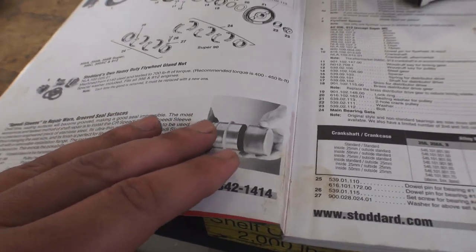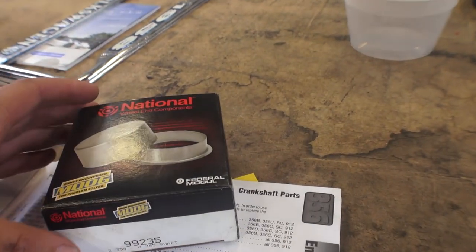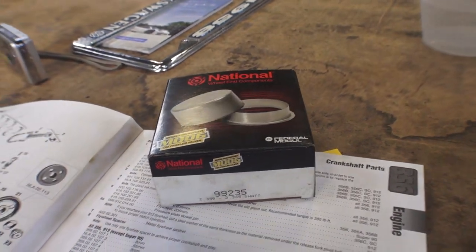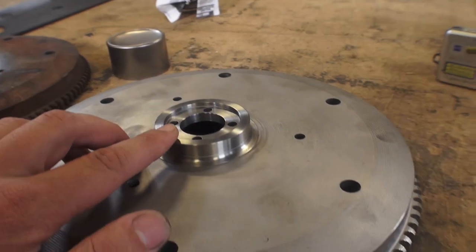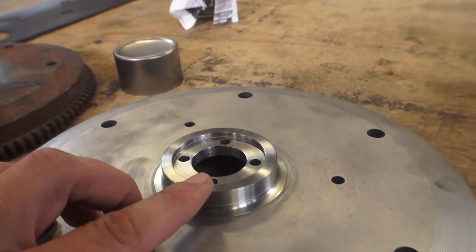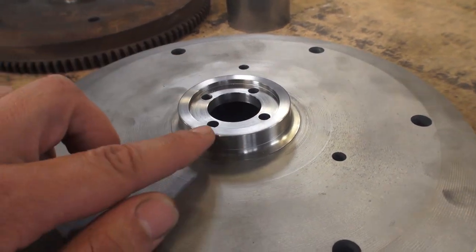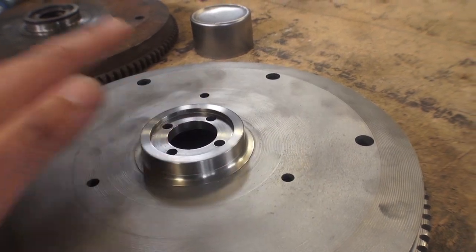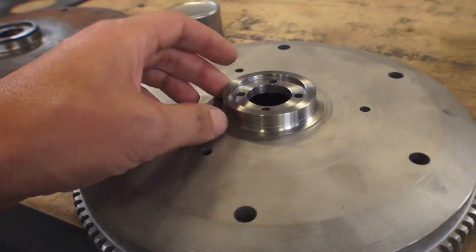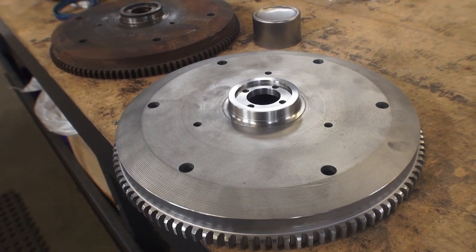Prices for these things vary. Stoddard is about $50-$51 for these sleeves, or you can find them online. I found one online when going through the Samba forums — guys were telling me that part number 99235 by National, if you do a Google search for that, you'll get this sleeve. What we did find when we got this sleeve in, the sleeve was a little bit higher than the neck of the flywheel. You need to have that flush, because this rides up against the shims that are inside around the edge of the crank — you don't want this rubbing against the shims. So we sent this out to get cut straight off. You can take this to a machine shop, they'll hammer the sleeve down for you and cut it flush, and you'll have a brand new looking fresh neck on your 36 horsepower flywheel.